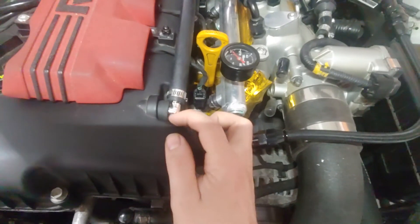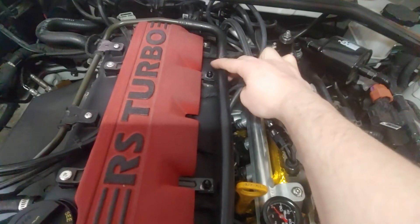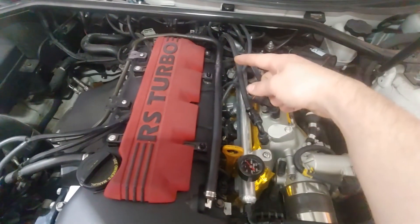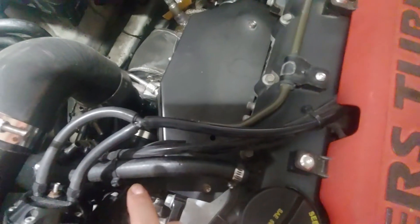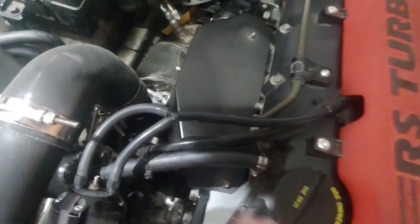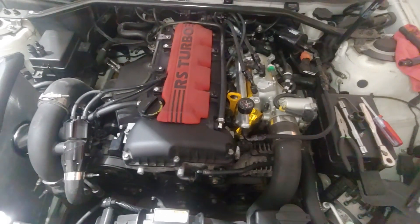That little foam piece that covered this up — I just cut it shorter and then stretched it around after I tightened this up with a hose clamp. I have a little splicer piece because I couldn't find a hose long enough — it needs to be about 20 inches long with a three-inch leg so it goes around to this piece. I have a custom intake, so essentially all I have to do is run my hose from here to my intake and I'll be done. That's what it looks like once everything is in place — pretty simple.